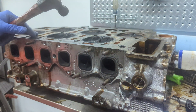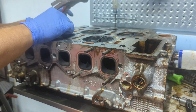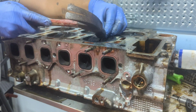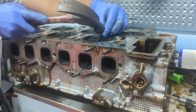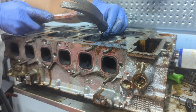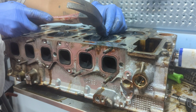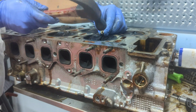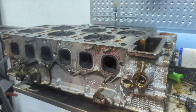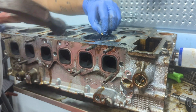So again, I'm matching the angle — this is what you use to put the FSI seals back on — and I'm matching that pattern and just lightly tapping. This is a light tap. Once it starts to move — it's already starting, I can feel a little bit; it's already moved a little bit. I'm continuing to tap, just loosening up that seal. There's still enough wiggle room that I know I have a little more room to go. It's going — now I'm switching to the smaller one in the kit, and there you go: you just heard it fall through the cylinder.